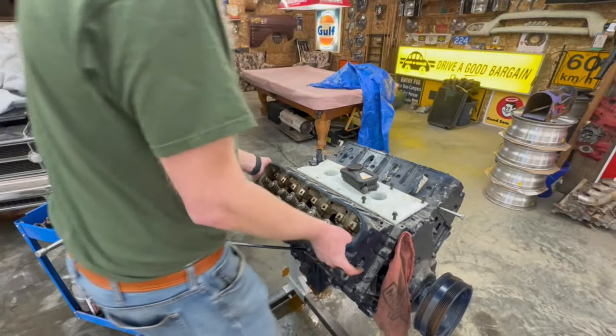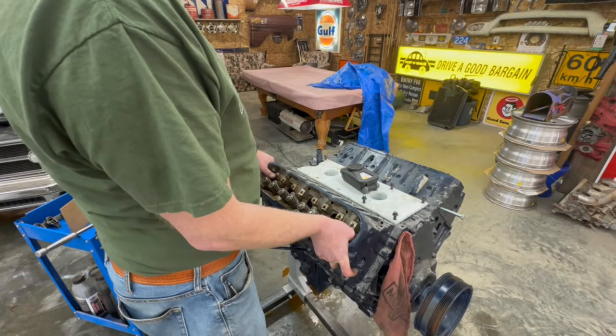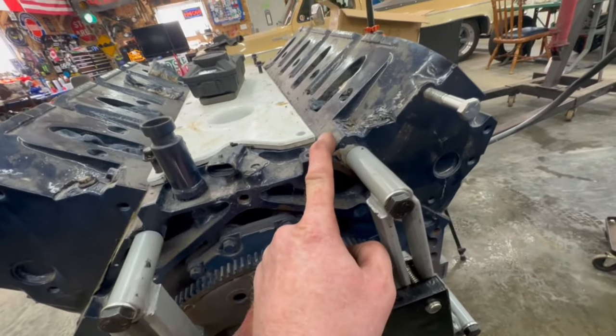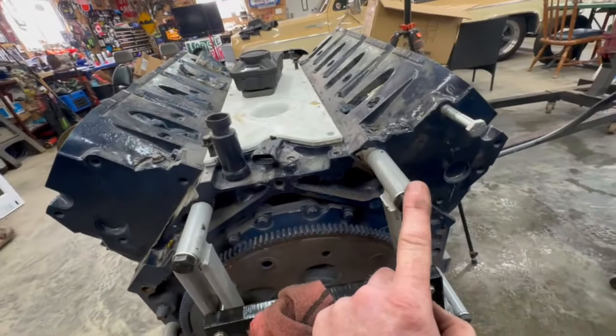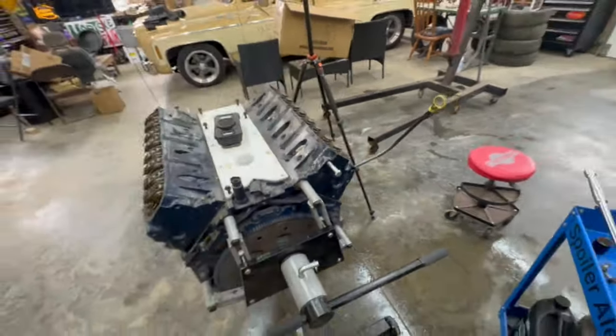This will just pop right off here and plaster my boots with oil. Guess what I just realized — when putting it on the engine stand, you don't want one of your engine bolts going into the head. It was down here but it was too low. This one's okay because that head is more forward. I'm going to have to take this and move it because I don't think it'll fit in that middle hole. You live and learn. We're going to get this engine stand mount fixed up — I'll be right back.